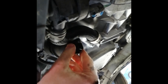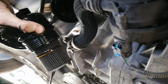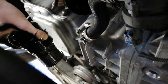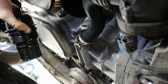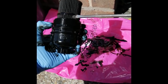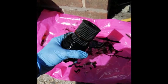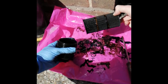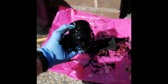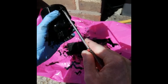Just watch the fact that the oil might go everywhere — the wind is going. And then out comes the oil filter, like so. Let that drain out. Just give it about another 10 or 15 minutes, just until the oil stops draining. As you can see, some oil is still coming out of the sump plug. So when you take the oil filter out, all you want to do is get a screwdriver and push into the side of the filter somewhere. Push it in and just bring it out and it will pop right out like so. Take the oil filter element out. Make sure it doesn't go anywhere. Drain as much oil as you can out of the filter cup housing. And then take the seal off on the outside as well, like so.